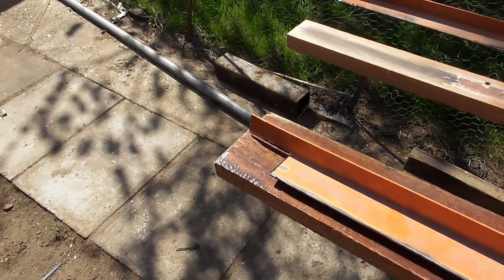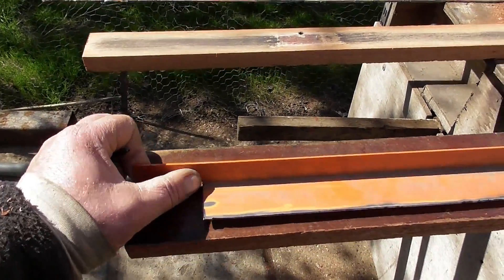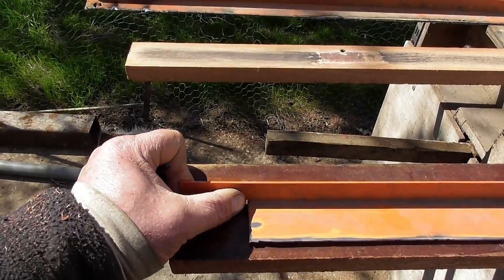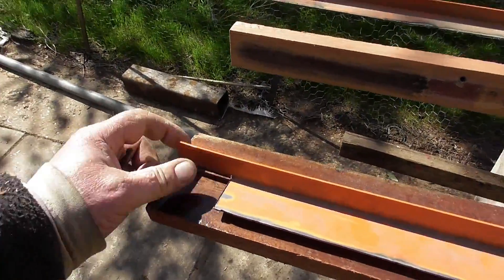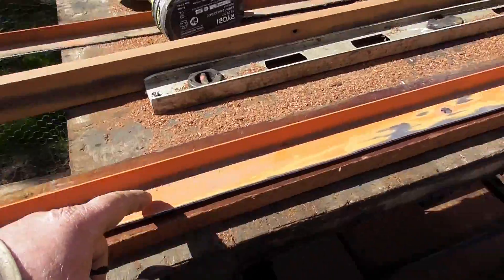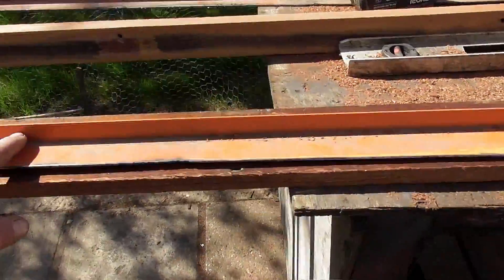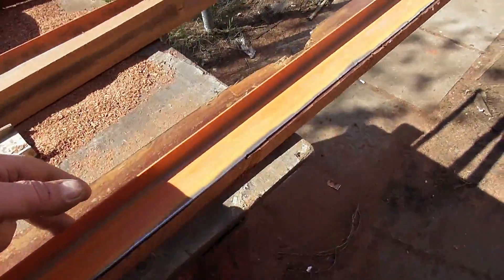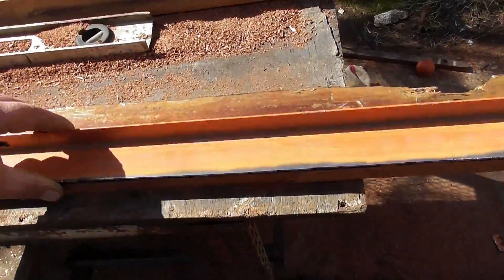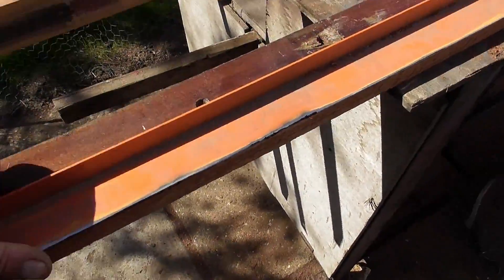My only concern is I'm not quite sure how I'm going to get a piece of wood to stick to that. I've now got to drill a series of five-mil holes all the way through including all the way up there, and then I will get some black sealant and glue this piece of wood to that surface behind. This will get laid onto the roof with black sealant underneath the wood, and then we'll use the pneumatic rivet gun to whack it down — and that will be the first seal.